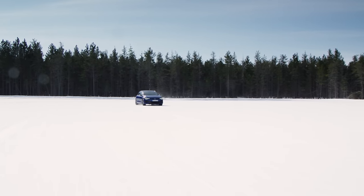The Focus RS is still all-wheel drive and will still try to pull you out of a drift. If you really want to drift, a rear-wheel drive car is easier. But the taller rear gearing is clever because it allows the rear tires to spin faster during a drift. The downside is the clutch pack absorbs constant slip during normal driving, generating heat. Engineers account for this and will open the clutch packs to allow cooling if they get too hot.